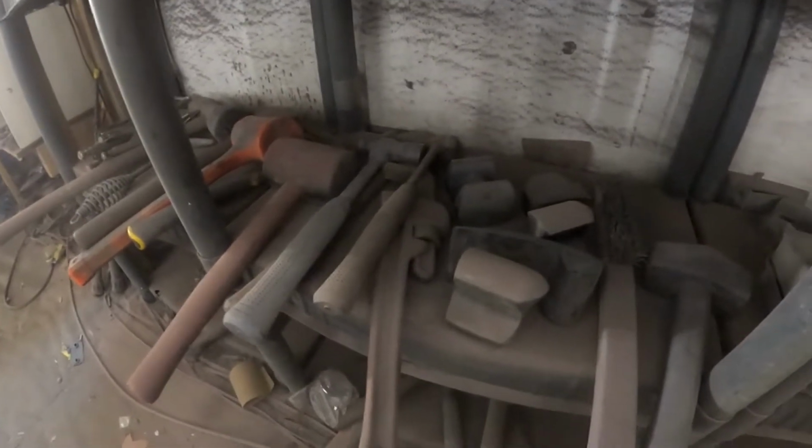And that is almost crucial. On this particular bend, in that particular spot, it's not, but most times it is. And if you want a demonstration right there at your own home on how that shrinks that metal up, get a napkin or a paper towel or a Kleenex or something like that. Set it on the counter or set it on a cushion, and then put even just one divot in it. But before you do, make an outline of the outside of it.